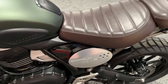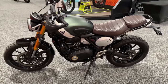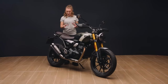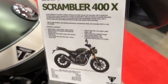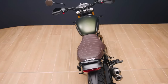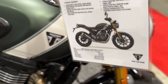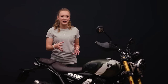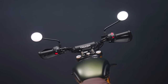The TR series engine is highly impressive in both models with its competitive power figures. This single provides a broad spread of power but does its best work in the mid-range. Throttle response is direct yet smooth, but when modulating on and off the gas at low rpm in gears one and two, the fueling is snatchy and abrupt. Alleviating this requires riding a gear high or feathering the slipper-assist clutch — short shifting to third and even fourth gear at relatively low speeds eliminates the twitchy throttle while still providing smooth, tractable power.